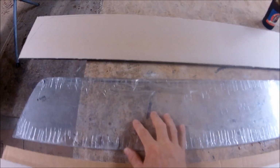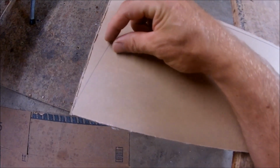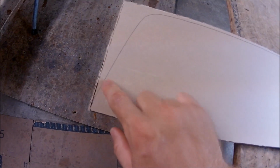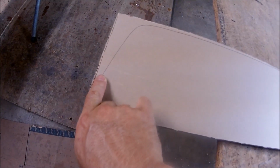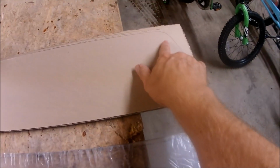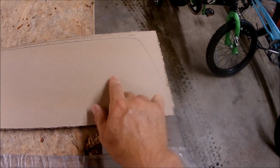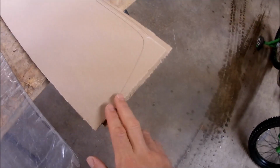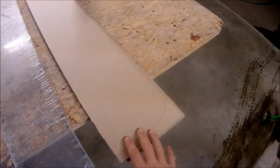So when you get these in the mail, you need to fit these on your car and make sure that it lines up, and you want to make sure there's at least about 3/8 of an inch gap on each side, because you need expansion for the heat of the sun. So make sure it's not dead hitting the metal on the inside. Have a little bit of a gap on both sides, and I'll write on here, grind if needed with sandpaper. 80 grit should be fine. Grinders work, air grinders, or just by hand on a block, and sand it until you got a little bit of a gap, because every car is going to fit a little bit differently on that.